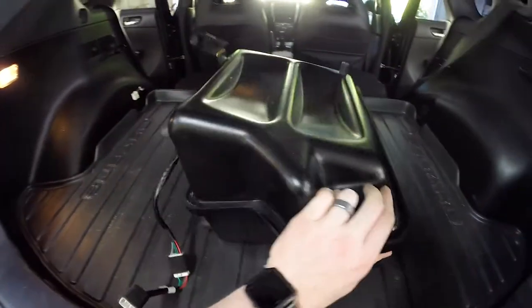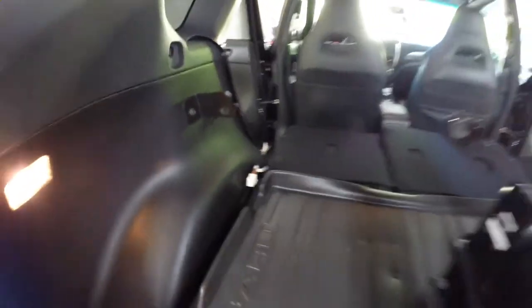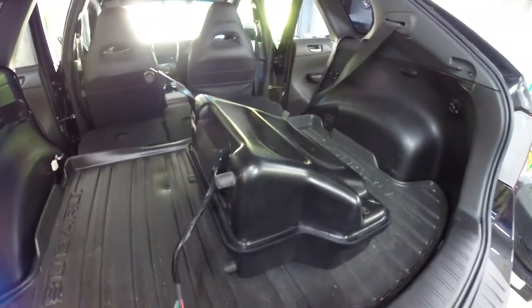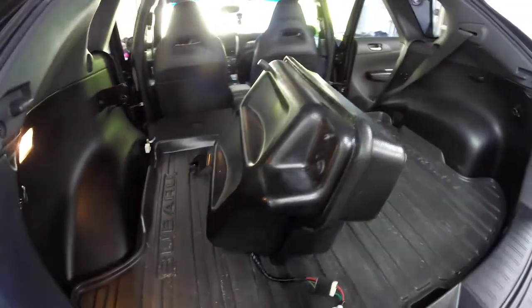My first steps: I did the wheel turning, I have to disconnect the negative battery cable, and then remove the subwoofer, rear tray, rear seat bottom, and some trim panels. I also have to pull the car seat out of the back. The factory sub is out now — I wanted to show this thing. It has the amp on the bottom, it's powered, has brackets and thumb screws. From what I've been told, it runs to the factory front speaker to get its source, which is not the best place. It's definitely not run to the battery like an aftermarket sub would be.